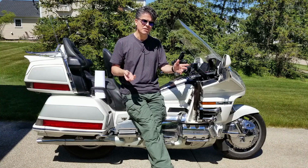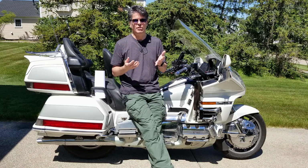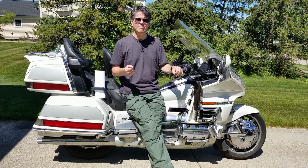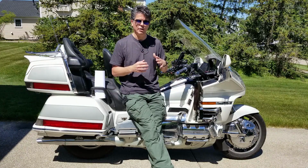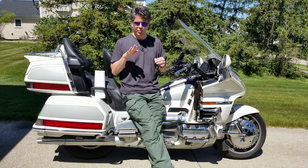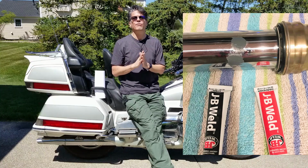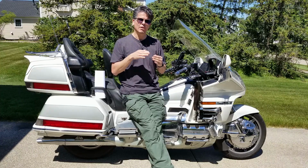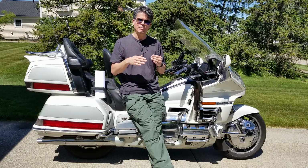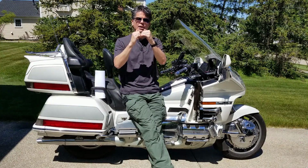Not necessarily. There's things you can do, and what I normally will do to get another few years out of a shock that this has happened to is I'll take some JB Weld, and I'll put a link to that in the description down below. JB Weld is just a fantastic all-purpose epoxy, and it's incredibly hard when it cures. So I'll mix up some JB Weld, and I'll just smear it over that scratch. Now, if the scratch is raised up and it's tearing at the seal, you might want to take some very fine sandpaper and get that lip down. But as long as it's just a divot, where a scratch has taken out some of the shock, this works just great.